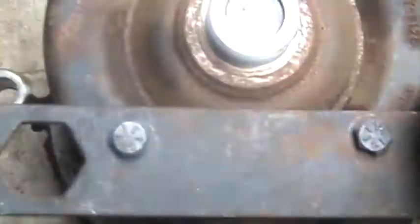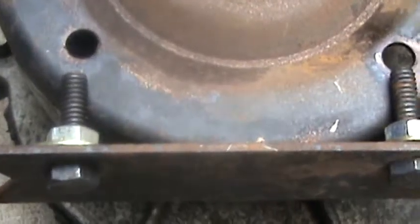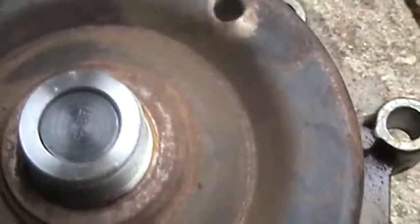Sorry about the shaking there, folks. It matches up absolutely perfectly to the fan hub. You just roll it in there. This long part back here rests right back against the AC compressor. And you can get your pipe wrench on that big nut and you can pop it right loose. Anyway, it works. That's all I can say.